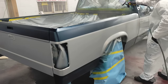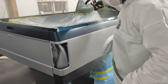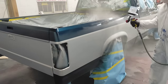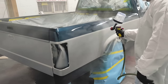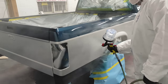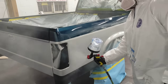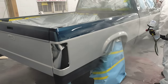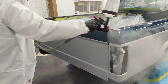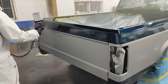Many of you guys know, I work with a company that sells 30 different types of clear coat and hundreds of different products. So I constantly have to kind of reinvent the wheel and reteach myself how to apply these products. The Fast Dry EuroClear, I find the best method with this clear coat is the first coat, you put it on a full seal, but as light as possible. Don't go heavy. A full seal, like a light to light medium coat. Just enough clear to cover over the base and provide a full seal.